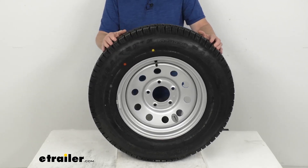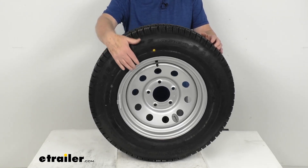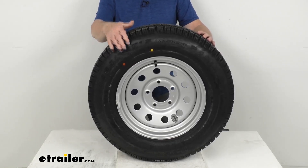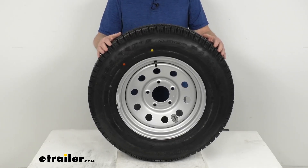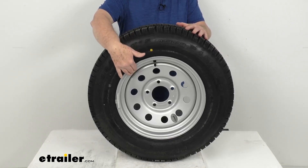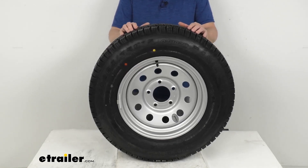Match mounting of tires and wheels is a process in which the tire installation position on the wheel is specifically selected to minimize final force of imbalance, or to cut down on how much weight is used when putting the balancing weights on. Basically, they align the tire's lightest spot with the wheel's heaviest spot, which eliminates most of the radial force that can cause tire and suspension wear.